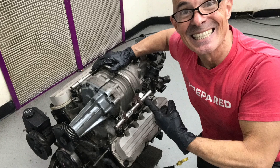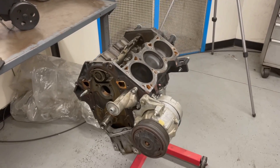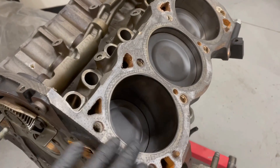I have an L67 3800 supercharged V6 from the wrecking yard. We're going to take it all apart, find out what the ring gap is the way it came from the yard — does it already have enough? Who knows, we're going to find out. Then if we don't have enough, I'm going to use our fancy little ring grinding tool and show you how we add ring gap to a big bang mode. We've got our 3800 and what I want to do is prep this thing for the big bang. I want to resurface the deck.